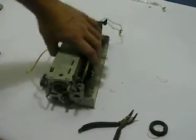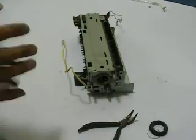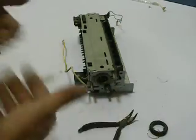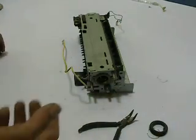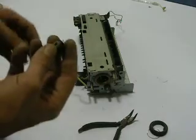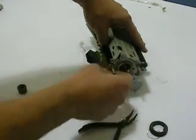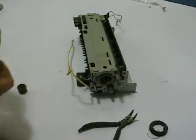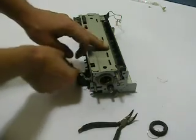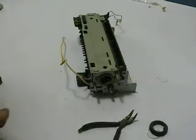The roller's out. I'm going to go to my other core now because it's going to speed things up. This core is the same thing that we just had — all taken apart. On the two shafts where the metal gear goes, you want to put a little lubricating oil on it and clean it down. Don't use anything flammable because that lamp gets so hot — if it was an extremely flammable product you could be at risk of a possible fire.